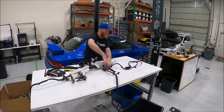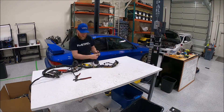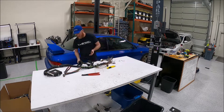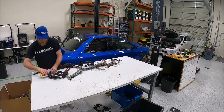When doing a harness merge, we surgically take apart the harness from the chassis as well as the body harness that matches the engine. We then wire them together to get the benefit of the new, more powerful engine in the car while still keeping the creature comforts from the original chassis. Here, Brian is stripping the STI body harness that we will be utilizing for this project.